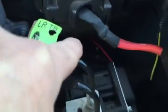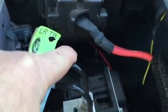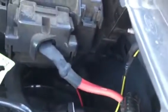Anyways, so this wire here has been fed. If you can't see, there's a grommet located on the floorboard underneath the high-end part of the dash that runs into the engine compartment. So from that point on, let's go to that. If you can see down there where that red wire is, where the grommet is located, from the inside of the cab to the engine compartment. If you follow that red wire, it's also the wire harness for the light bar all the way through. And the fuse has been mounted, drilled into the side of the fender, of course wired into the battery. The other part from that pigtail and that wire harness is actually left inside the cab, which I will swing back to right now.